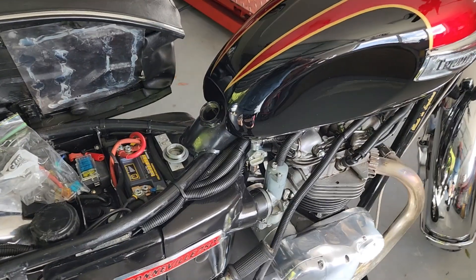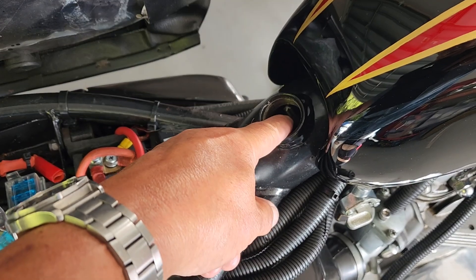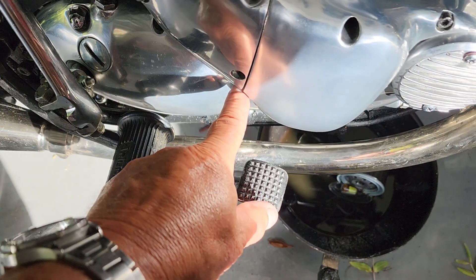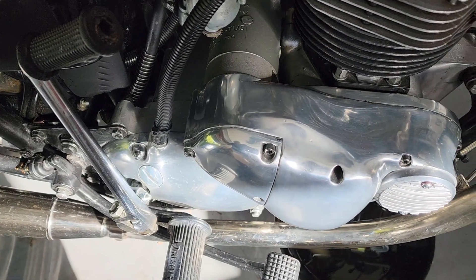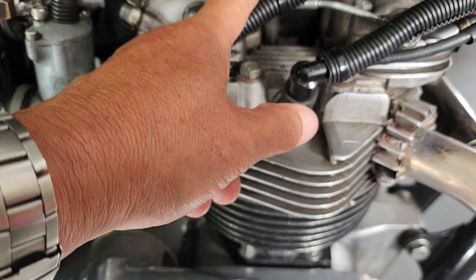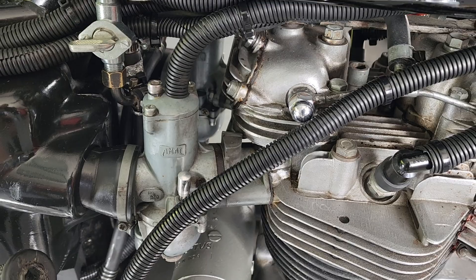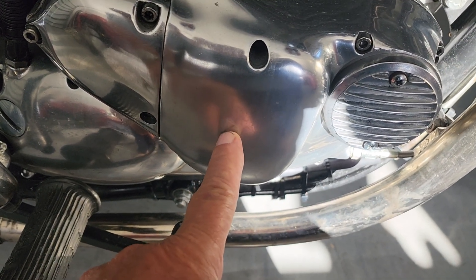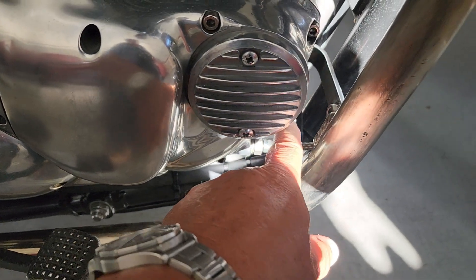So let's cover the oil circuit. You have two basic oil circuits: the return line and the pressure line. The return line comes out through here, fed from a line off the pump. That pump picks up oil from your crankcase and blows it back into your tank — that's all it does. At the top there is a feed line that feeds your rockers, so your rockers are fed from the return line. The engine is fed from your pump to the gallery, where it's distributed to your crankshaft and tappet blocks, and also there's a line that feeds your oil control valve.